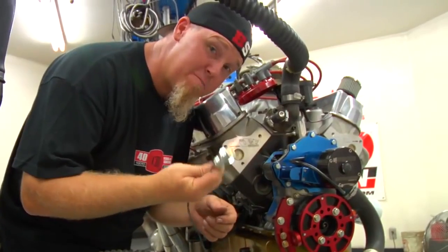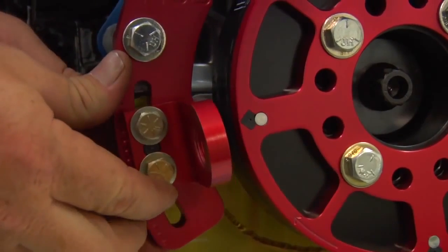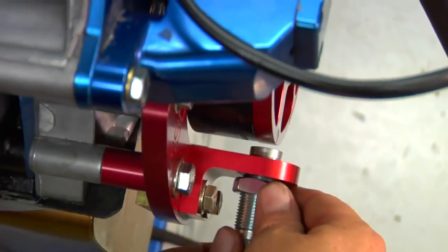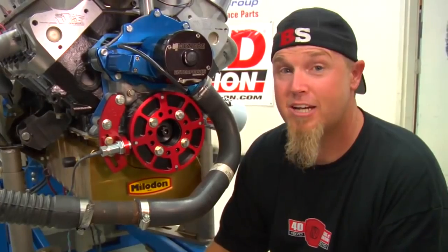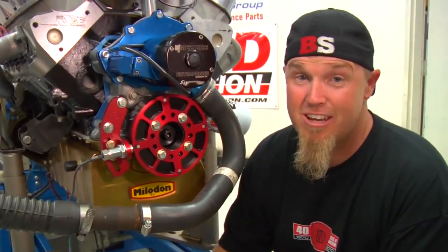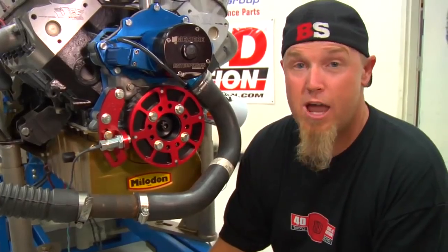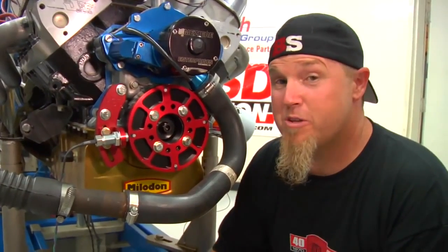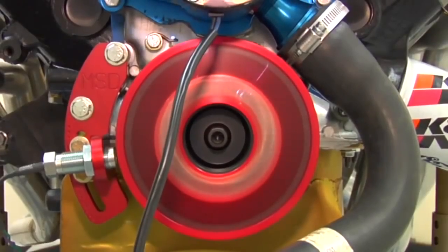The final component to install is the non-magnetic pickup, but before you thread it in and tighten down the bracket, make sure the bracket is centered over your magnet and that you've used the correct spacers so the non-magnetic pickup is centered over the edge of the wheel. A common question on a crank trigger setup is how big an air gap to set between the non-magnetic pickup and the trigger wheel. If the engine starts it's probably pretty good, but as a spec, between 50 and 80 thousandths is right. We've set ours to 65 thousandths — just enough clearance to get the feeler gauge in. Don't go any tighter than 50 thousandths because if you get any harmonic balancer wobble or crankshaft flex you might take out the pickup.